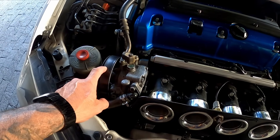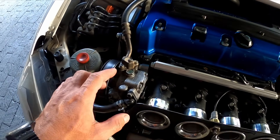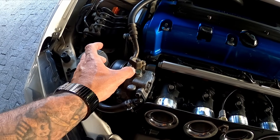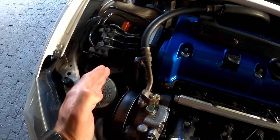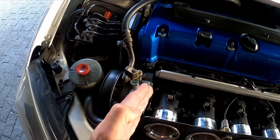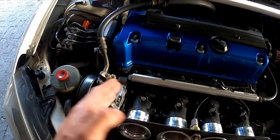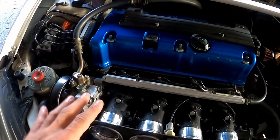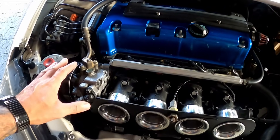The DC5R comes with hydraulic power steering, the EP3 comes with electric power steering so it doesn't have this big lump in the middle. A common thing guys do is take this off and put an idler wheel delete kit, so you have the space and can run the throttle straight — which would probably give better power, response, and airflow.